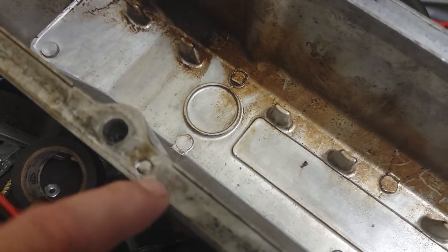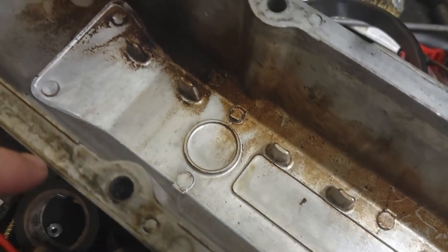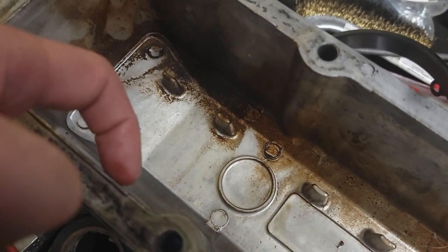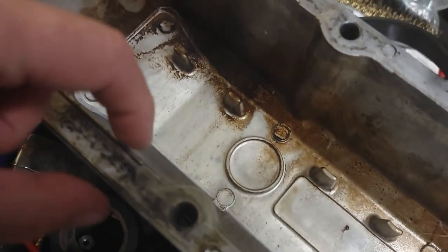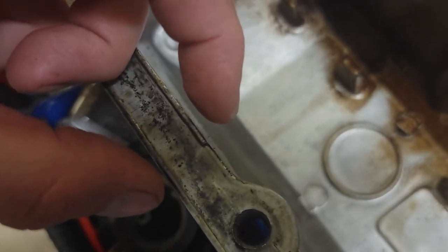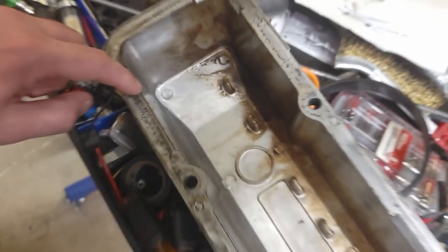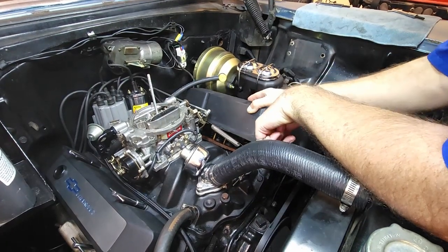starts here. The rubber ones, smaller ones, fit on this side of that edge that keeps the gasket from bulging in and creating a gap that the oil can come out. But with these cork ones, they're extra thick. They're sitting that wide. I gotta do this because otherwise it wants to focus on the backside. So this is making an impression into that gasket. I think for the meantime, I'm just gonna tighten the living crap out of it. The rubber ones are like $40.